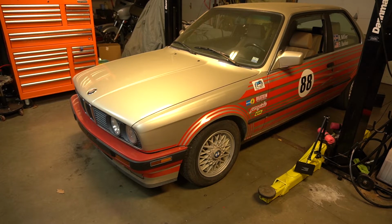I have a bunch of fuel. You can smell raw fuel when you crank it a while. So speaking from experience, I'm going to go ahead and try replacing the crank position sensor.